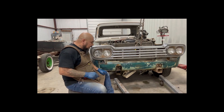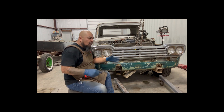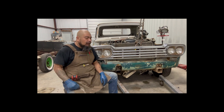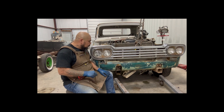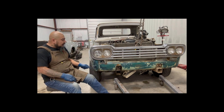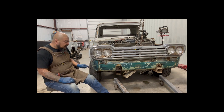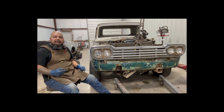From 1958 to 2003, these frame rails are only a quarter of an inch wider than the original frame. I thought that was kind of cool. Right now I'm hitting on the frame horns — or frame ears, frame horn, I'm not sure what they're called. Anyways, I'm about to cut them off. I don't need this much frame sticking out. I'll just cut the ears off so I'm able to set my fender down, and then we'll take a look at the sides and see what it needs from there.